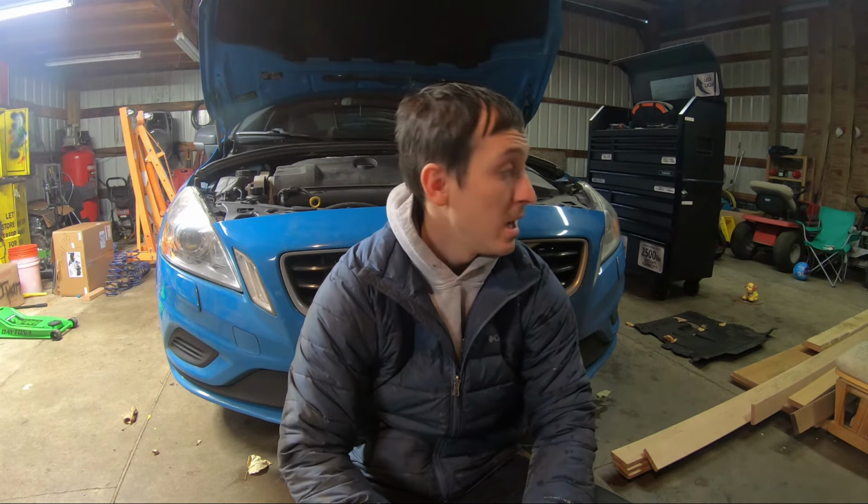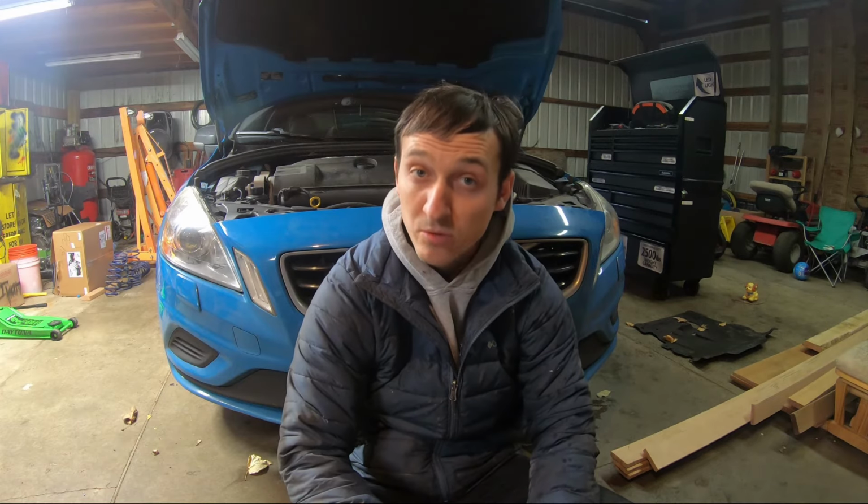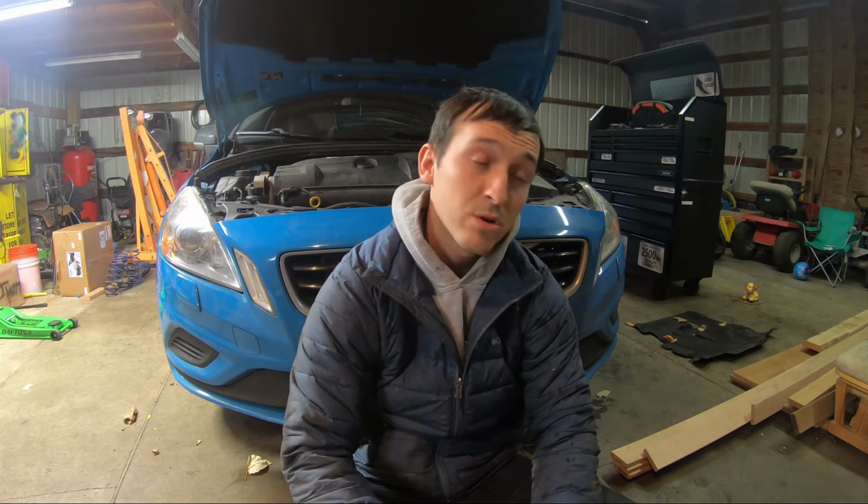Especially with Volvos, their transmissions are kind of touchy, so you want to maintain them properly. Obviously, for the transmission cooler, I have that video on my channel. It's going to be really beneficial to your transmission. If you drive your car hard, I would recommend adding an external transmission cooler, because the torque heats the transmission up pretty badly, and when the temperature gets too high, it starts damaging your transmission. You're welcome to check out the transmission cooler install video.